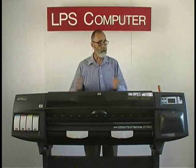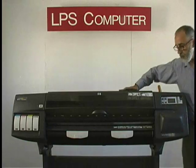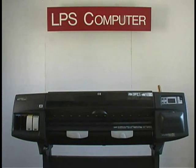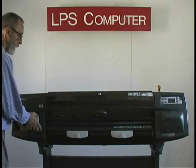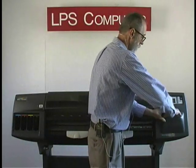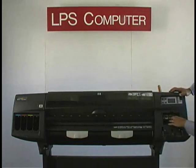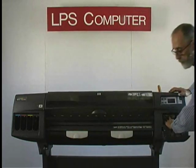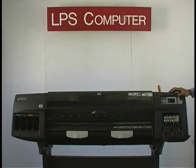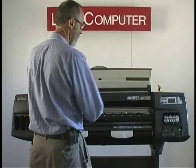The first thing we're going to do in replacing the ink tube system is to get the supply items out of the machine, which means we have to take the ink cartridges out and the printheads. To get the carriage to move, we're going to have to get it away from the service station. To do that, we need to reach in and pull the printhead cleaner drawer forward all the way. You'll be pulling against the motor - there's a little resistance there, but you don't hurt anything by pulling it out.